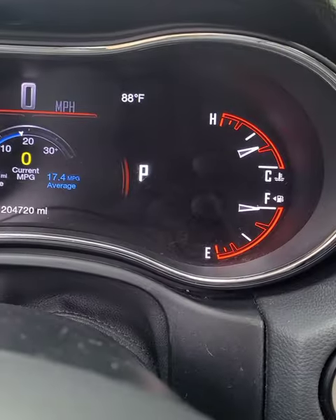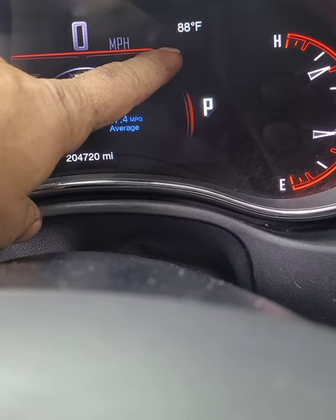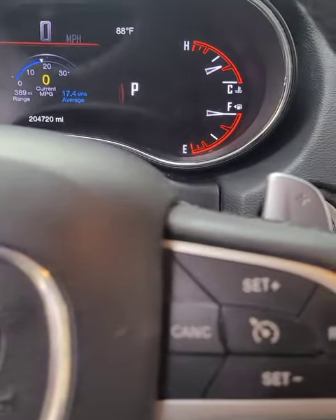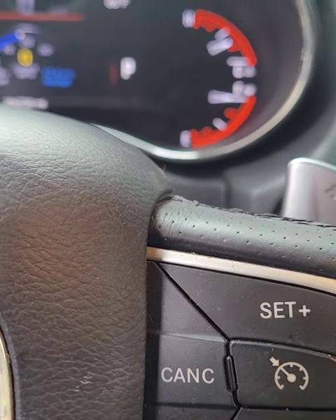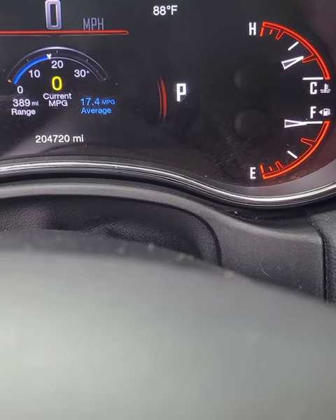Now that we're done with the install, I'm burping the coolant system and so forth. The check engine light would be in the upper right-hand corner next to the outside temperature, but we have no issues. Luckily, given the fact that the oil pressure sensor did not match the original one that was taken out, hopefully it stays the same and we don't have to change it — or she has to change it out when she arrives in Texas. Only time will tell, but so far, so good. Just waiting on the coolant system. Jamie with Ham Racing — thanks for watching.